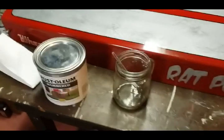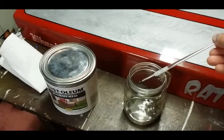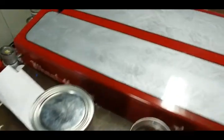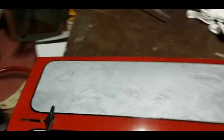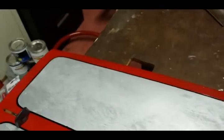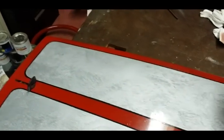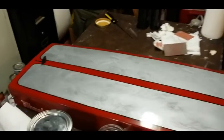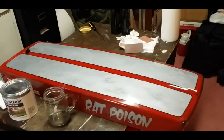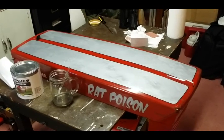With a little hammered paint and a small artisan brush — one I got at Home Depot, nothing fancy — I went ahead and dabbled a little bit of paint over the dark spot. There's obviously a small blemish look right there, but I'll give it 24 hours to dry, hit it with a 3000 grit foam pad really lightly, then some compound to blend it all away. That's the goal. Next, we'll put the hood back on the tractor and see what it looks like all together.